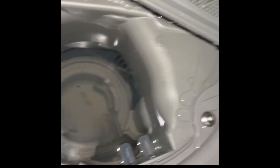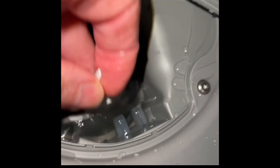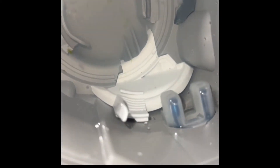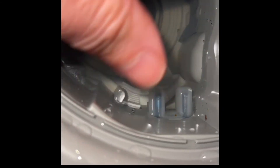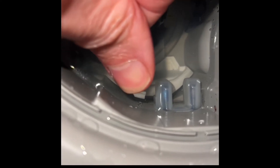There's the impeller. This thing is the impeller cover — we're going to put it back in. Just slide it down into position. Now we've got to make sure we click it in. At the top there's that little triangle tab we looked at before — we've got to make sure that thing is clicked in. I'm going to push this down in and then push in on that piece. I heard it click in. That tab at the top is clicked in — that's good. That way it won't move. If it gets loose, it can't create the pressure and you get the E24/E25 error. Make sure that thing is down in there and clicked.